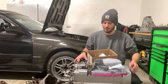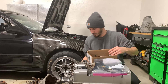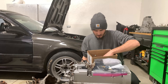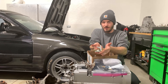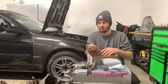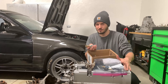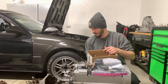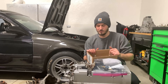This will help it not get stuck like the old ones do when they age. Now these transmission bolts are actually for the stiffener on the bottom of the engine. Then we've got these expensive boys - all of the bolts for the subframe that I didn't have when we were putting it in. The subframe is about half put in right now, enough to roll around. Honda's very proud of these - twelve, eleven, and nine dollars a piece for three sets of two, so be prepared to spend about sixty bucks on subframe bolts.